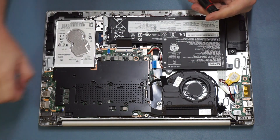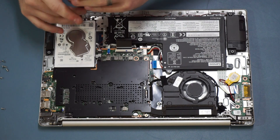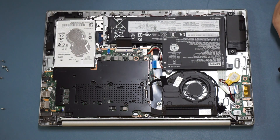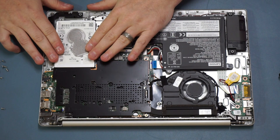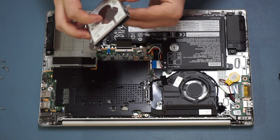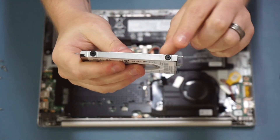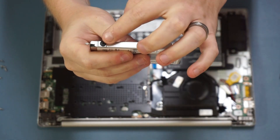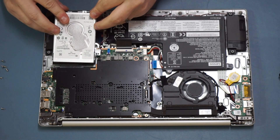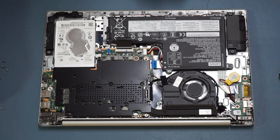It is important once you get to the inside that you keep the screws separate, because the screw sizings are slightly different depending on where they go, so make a mental note of which screw went where. With those four screws out, all we have to do is gently apply some pressure and pull the caddy backwards, and you'll see it releases from its data and power connectors, then the whole thing lifts out. We've got four screws holding the actual hard drive into the caddy — two on each side. Remove those four screws, the caddy separates, and we install our new drive in the same orientation. Putting it back together is the exact process in reverse.